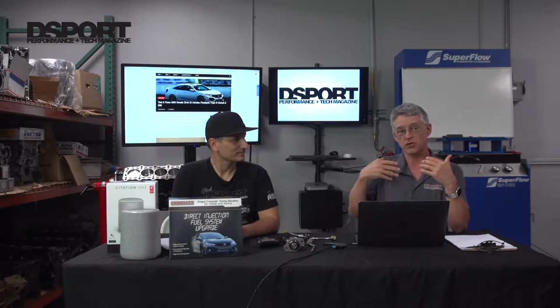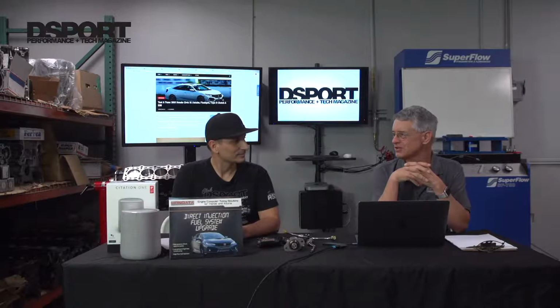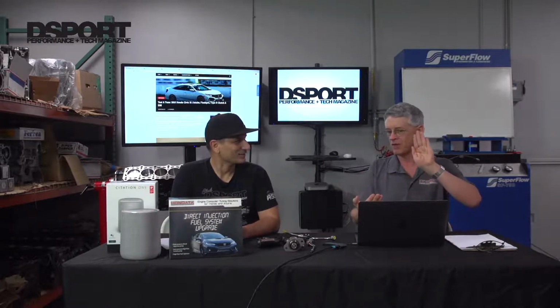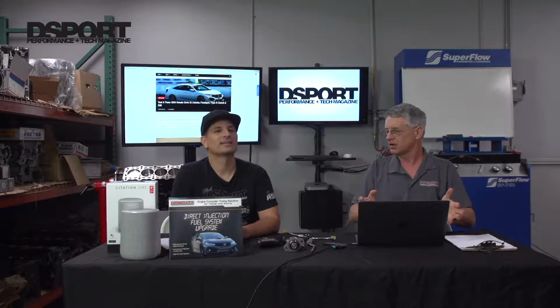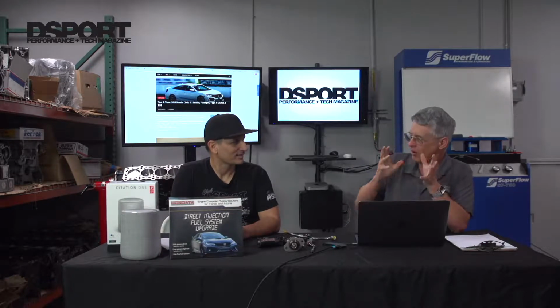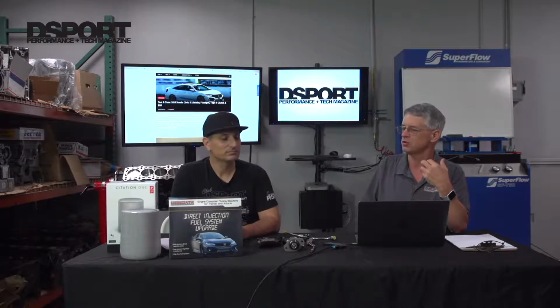Try not to make the torque curve too spiky, and also the driver. The biggest problem we see with CVTs is not the CVT so much as it's the driver. You get people who will throttle brake and give full brake and full throttle at a traffic light, and they'll burn up the CVT at a standstill. So the biggest problems we see are driving. But for our own purpose, we've run 30,000 miles on a CVT running flex fuel at a fairly high torque ratio. So to a good extent, it depends on the driver as well.